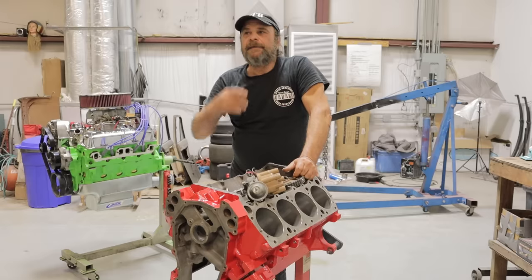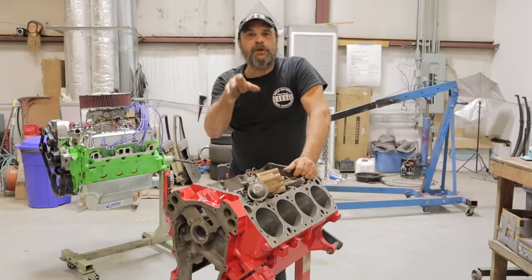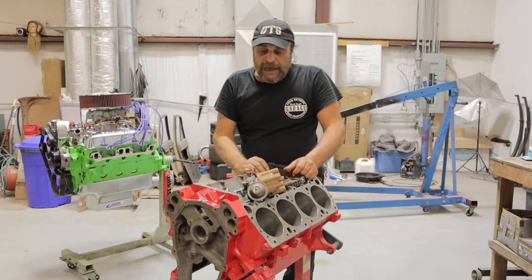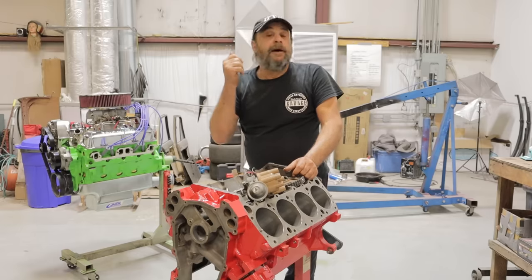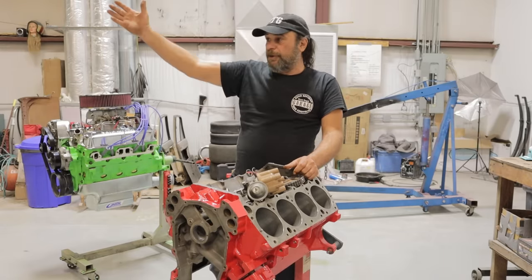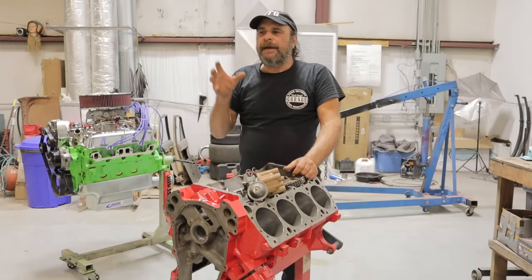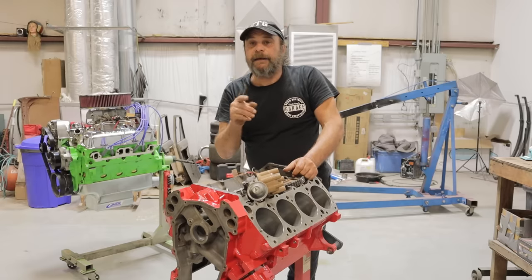After years and years of doing this it becomes almost a psychic, intuitive process. Now, with a fresh motor you set it by the timing light to the timing marks. Those timing marks are set by the factory for emissions purposes, given different types of gas and different altitudes. The ignition timing and the ignition curve as outlined by the manufacturer are all for that general usage, and it's all predicated on the engine being fresh.